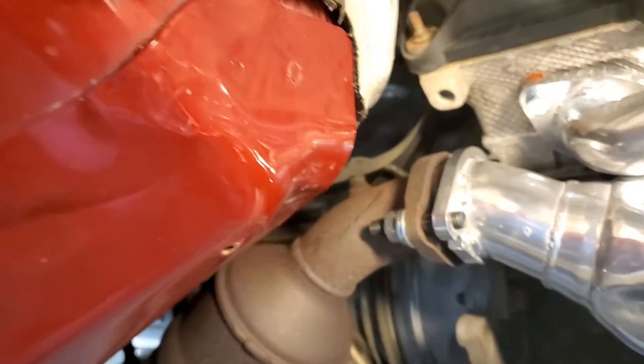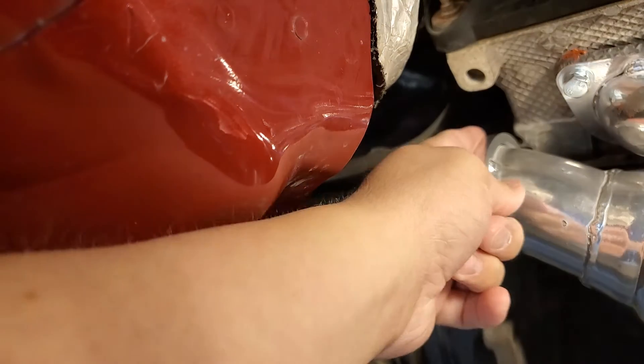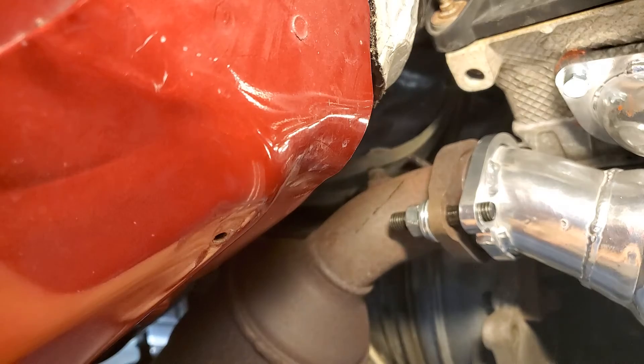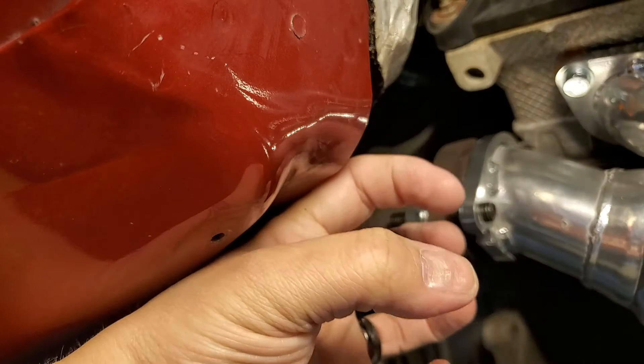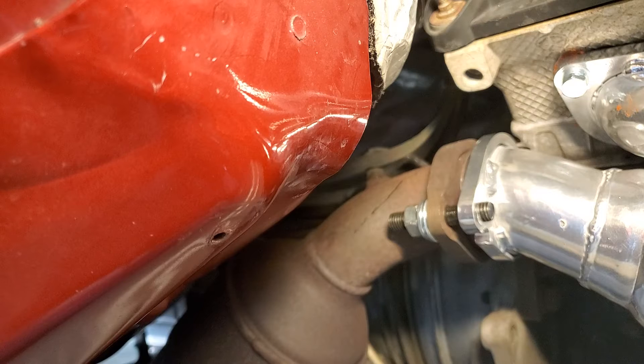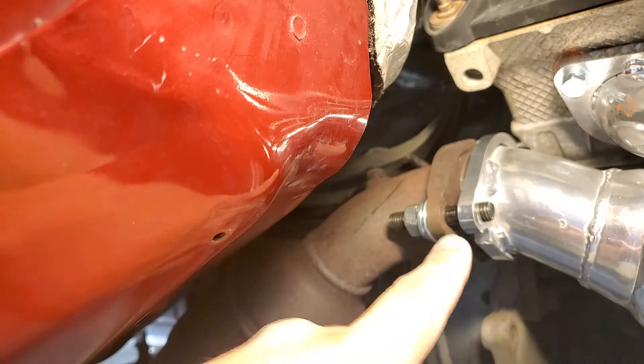Now back here on the collector, this is where we have some problems. Our collector has a gap right up along this top edge that's not sealing tight, and we've tried a few different things to get this to seal up. The only thing we can think of now is that we're going to have to take this loose with a friend of mine, take this all apart, and bend the top part of that flange so the bell goes back into place. If we do it wrong, we're going to wreck that bell. If we do it right, we're able to save the bell and reseal this header. If the exhaust leak isn't that bad, we may choose to just leave it and run it the way it is. If it gets too annoying, I'm probably going to have to put a new Y-pipe in, and at that point I'm going to regret not going with long tube headers.